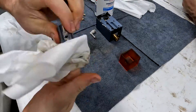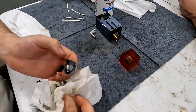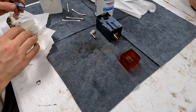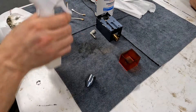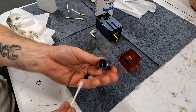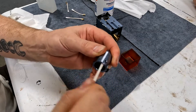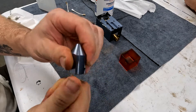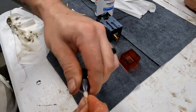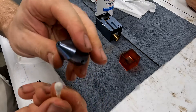Just clean up every little piece and part in there that you can and make sure it should come right back to a shiny finish. As you can see by the goop on that, there's a lot of stuff that builds up inside this little laser module — this was two days of laser use, so if you haven't done yours in a while, yours may look worse than that. Make sure you clean the inside of the air nozzle off. Most of the time since the air is pushing down through here it doesn't get a lot of resin buildup, but you still want to make sure the tip is clear on both sides so the laser passes through without going through resin, which may decrease your laser burn.